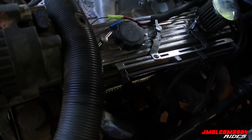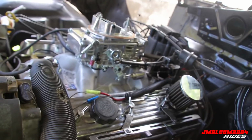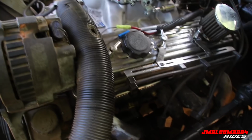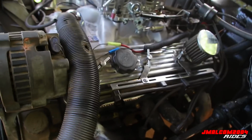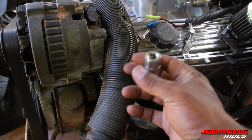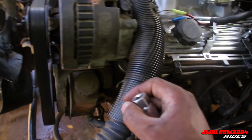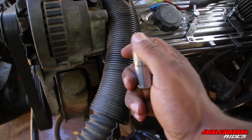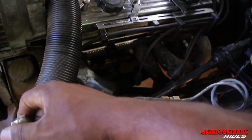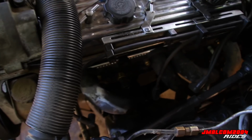I guess I can explain, cause everybody don't know. Pulling an engine, not really hard, y'all, but spark plugs, most of the time they 5/8. If you don't know what a spark plug socket looks like, this is what it looks like. It's 3/8 drive, or you can put a wrench on there, 19 or a 3/4 wrench, can go on here, you can turn it. That's what I'm using to take them out. 8 spark plugs. That's what I just showed is a spark plug, for people that might be learning.